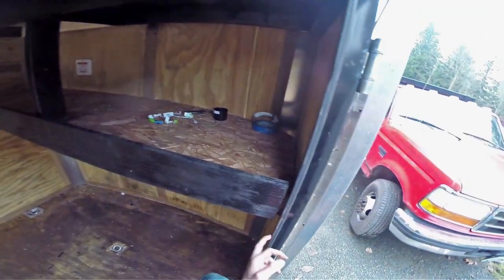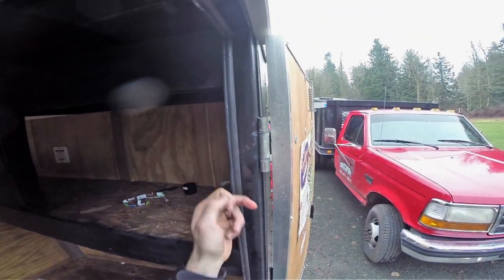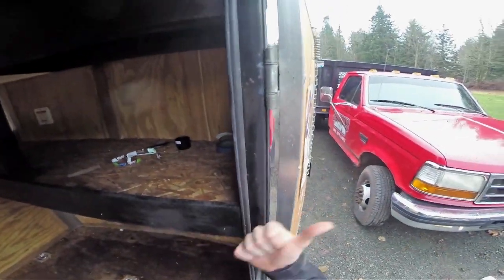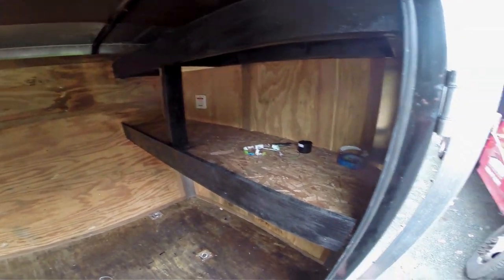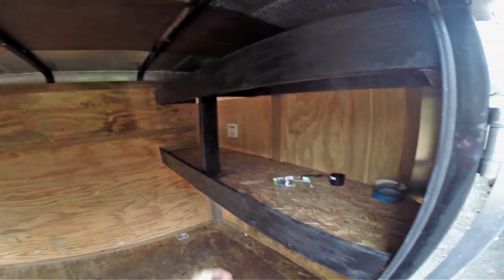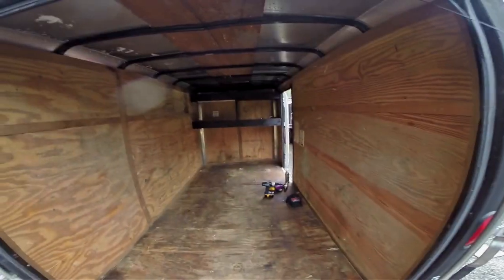Like I said, every trailer is different. But for this one right here, in order to go through a 2x4 and just enough to go into the wall where it's not going to pop outside, 2.5-inch screws work very well. We use about 1-inch screws just to hold the face plates and the top boards. You screw those into the 2x4s. So I hope this worked out for you guys.